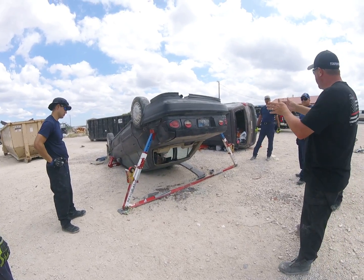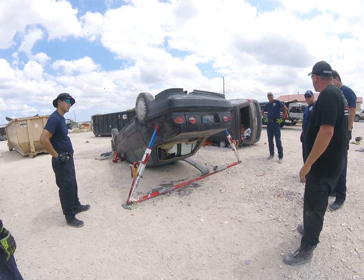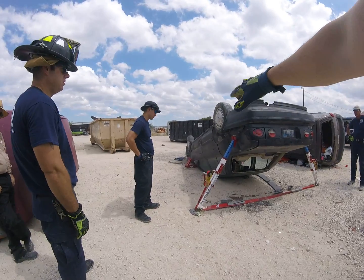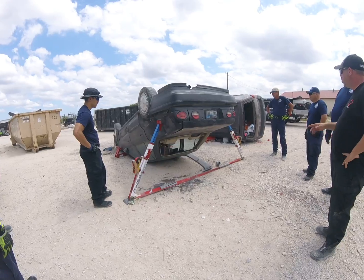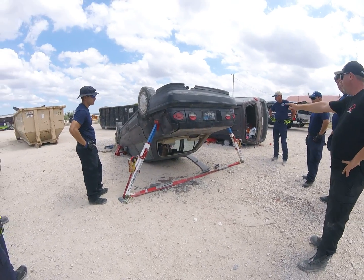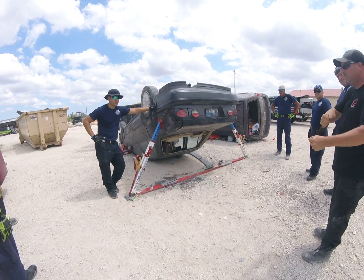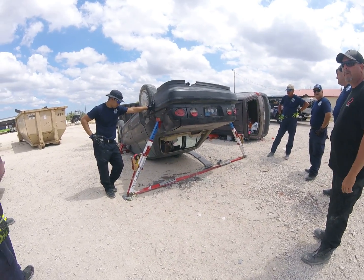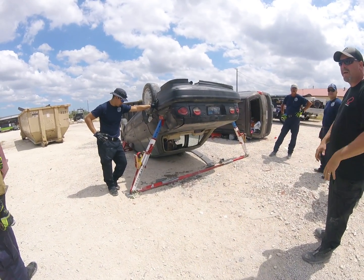You can take the roof. Now, if we take the roof and we want to take it to the left — as we look at it, we want to go that way — how do we cut the posts? Lower on this side, closer to the car on this side. Why? So they don't get caught when it slides out, so it comes through naturally. Same thing going the other way: cut low on this side, cut high on this side. It leaves us handles to grab onto so we can drag it out. Especially if we have a medic and a patient on it — we can bring them down onto the roof, start to package them there, slide them right straight out on the roof, and package right there on the ground.